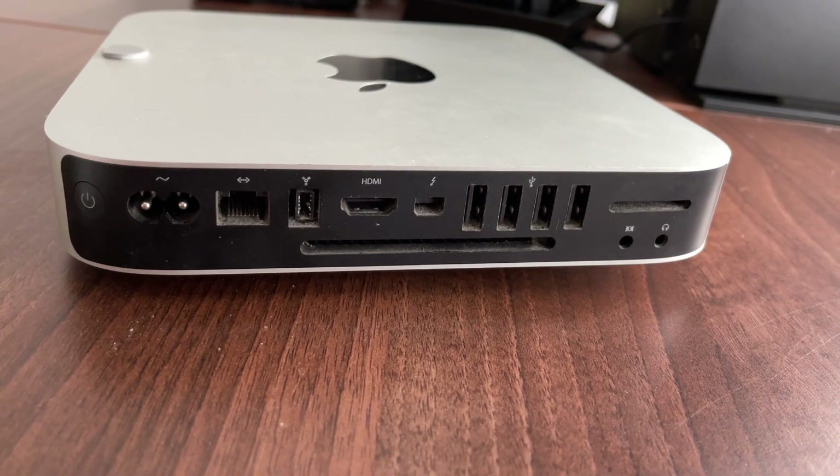Right, now we're going to get the operating system reinstalled. All I've done is put a blank SSD in the machine. The good thing with Macs is that the operating system is really, really easy to reinstall. So once you've installed the drive, you turn the Mac on and press the Command and R key to put it into recovery mode. That takes a few moments to load up, and then you've got a couple of little bits of software that you can use to reinstall the operating system.